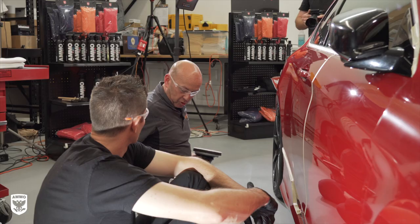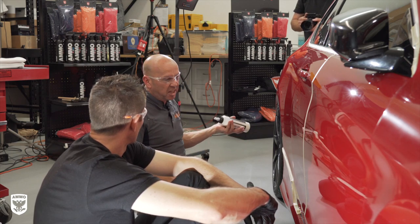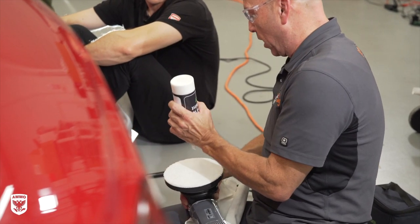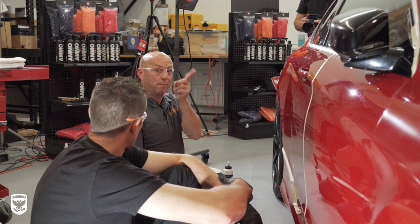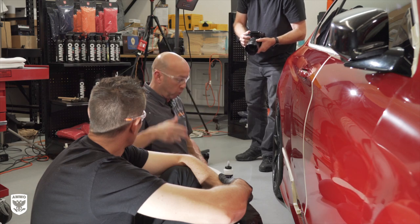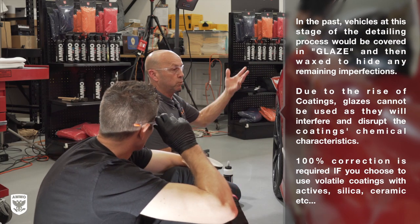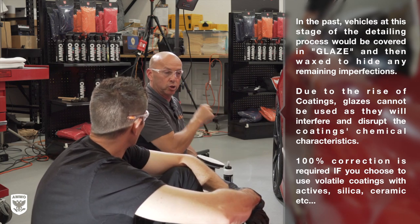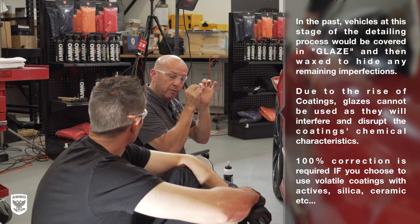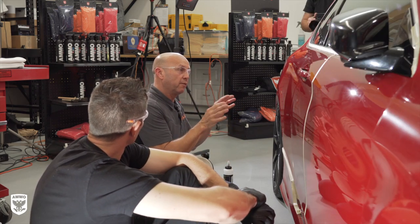If you're using such a diminutive size of polish — just the tiniest droplet and doing single one-way passes — that is never going to transfer across the entirety of the pad in one single one-way pass. So you take a quantity even smaller than a pea-size drop, cut that to a quarter of a pea-size drop, and place that at 12 o'clock, 2, 4, 6, 8, and 10 o'clock at the outer edge of the pad, because you're doing one pass and there's no time for it to migrate outward. You water spritz the pad because that's going to help spread it in that singular one-way pass. So on one hand we use water spritzing when you have an abundance of abrasive in the pad to pull it back out; on the other extreme, we use it because we're short-cycling with a diminutive amount of polish and need it to spread rapidly. Two entirely different reasons.